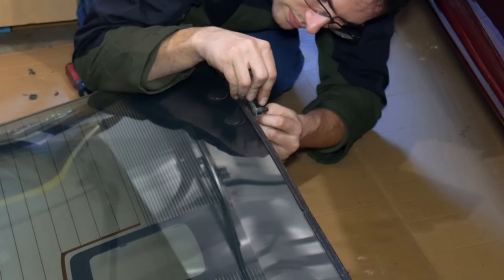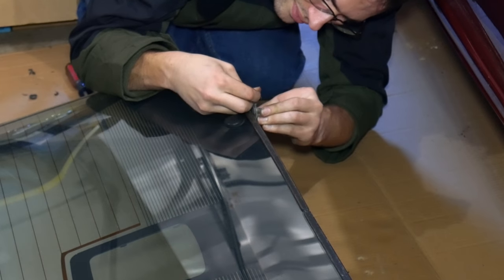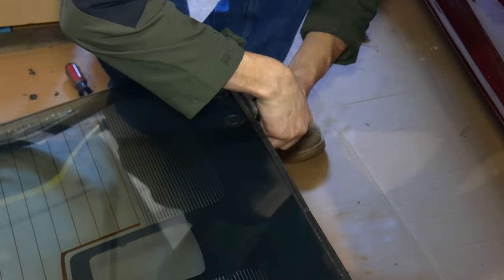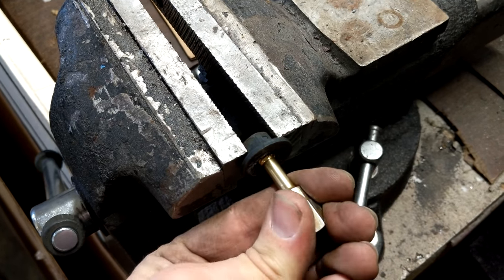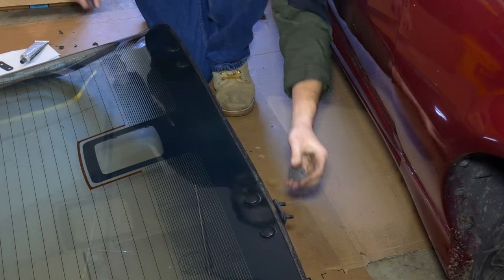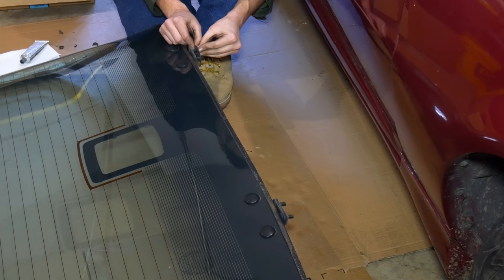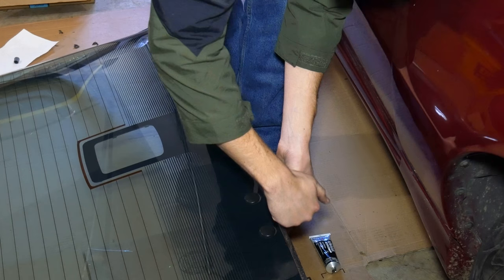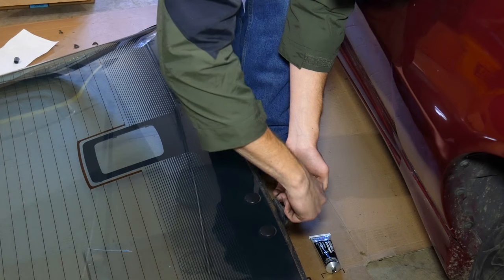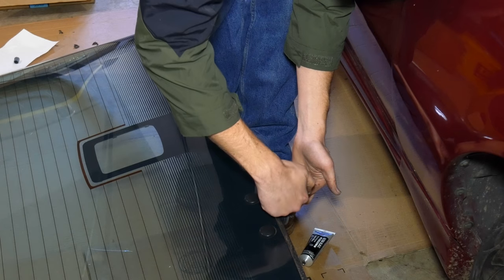Just like any other gasket surface, we'll remove remnants of the old gaskets and make the surface as clean as possible. We'll also use brake cleaner, a thread chaser, and a wire brush to clean off the studs. We'll do the same thing to clean up the washer surface and the threads on the nuts. We traced the old gaskets onto some generic gasket material and cut them out. Of course, we also cleaned up the hinge mating surfaces on the body of the car. We'll slide our new gaskets onto the hinge studs and carefully apply some RTV around the base of each stud. The gasket should seal to the body, but the RTV will provide a little extra sealing security. Once we've done that, the hatch is ready to be reinstalled.